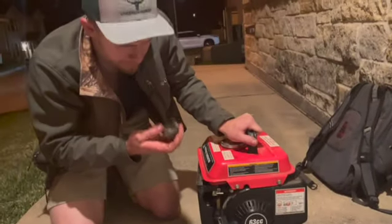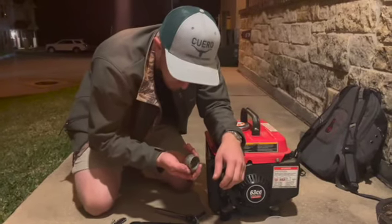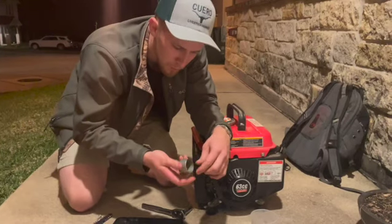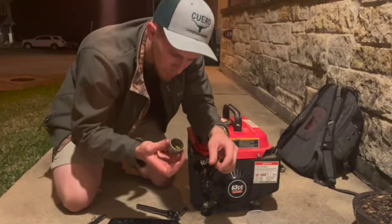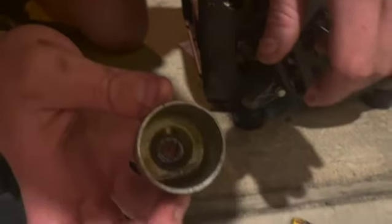We took the fuel line off — it produced good clean fuel, smells good. I tried to take the carb off but it's pretty difficult, there's really not a lot of room. So the next best thing was to take this carb bowl off. There's a little bit of trash on the bottom but it might be fine. Right here where the float is — there's a little needle and seat. That's usually what happens on these: that little needle sticks and you've got to pop it down. I'm going to have to take the float off.